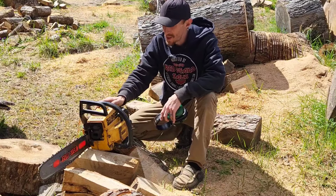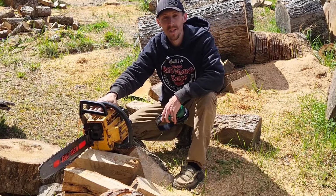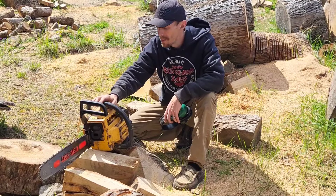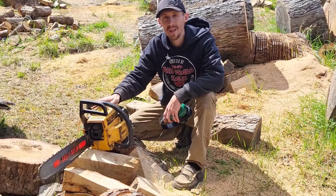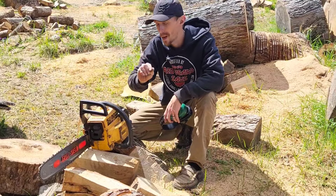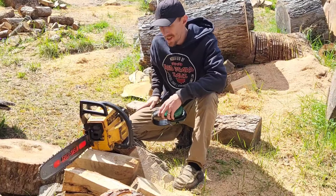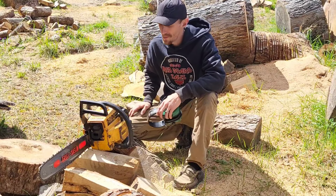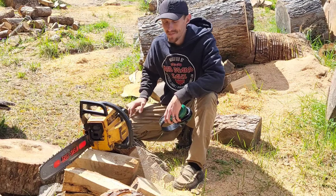Only thing we need to do now, go back in, correct the squish. I think we're gonna open the muffler up just a little bit more. Get a little bit of this heat out, because she does get just a tick warm. No air leaks or nothing, but just the way we got it ported, she gets a little hot.